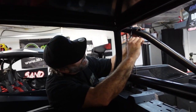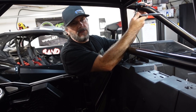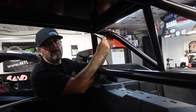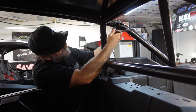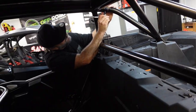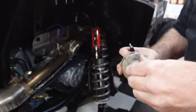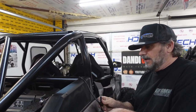What we're gonna do is cut the end off, put a couple holes in this cage down low — one down here, one over here — and run this cable hidden in the cage, because Rugged makes an insert you can pop on. We need a little bit of anti-seize on this screw. It's a stainless steel screw going into aluminum, and those combinations can gall the threads, so we put a little anti-seize on it because it was already binding up.